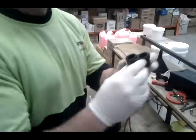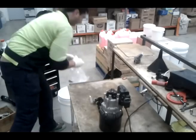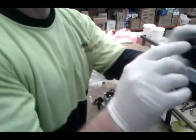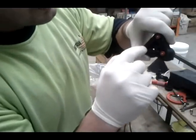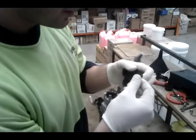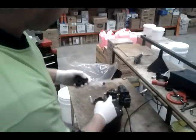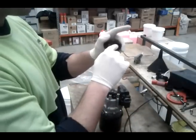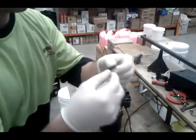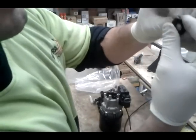Okay. Now what happens is, in here, there's these little valves, alright? And they tend to wear out over time and get little dirt in them and wreck. But what mostly wrecks in these valves are these little plastic rubbers, these little seals, and they go in here, and these little pistons in here just pop up and down, and they pump water into there. Now what happens is, if those seals are wrecked, these are my old ones, they tear like this. See that? And therefore you lose power, so you need to replace them.